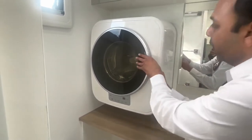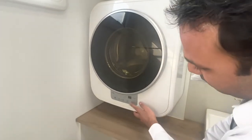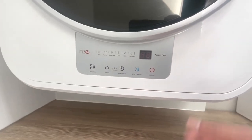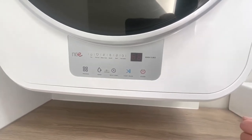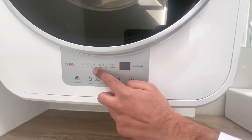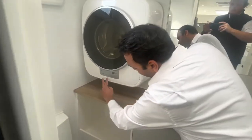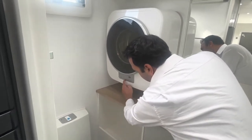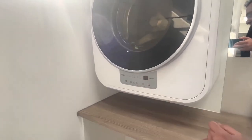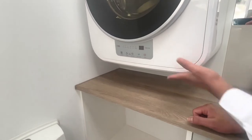Coming down to the ensuite, there's a washing machine — very simple and straightforward setup. Open it up, chuck clothes in, and open everything like that. Underneath is the power on/off button, start and pause. You can pause within the first 30 minutes; after that it won't let you pause because the tub is full of water. Different programs are selectable — hot water, normal water, baby care, quick care, spin, turbo clean and more. You can also set a child lock by holding the rinse and delay start buttons together. Press start and it washes by itself — the minutes will pop up showing how long the cycle will take.